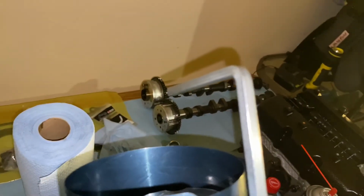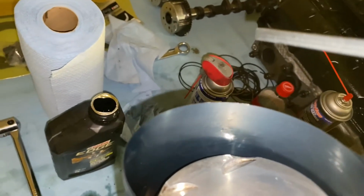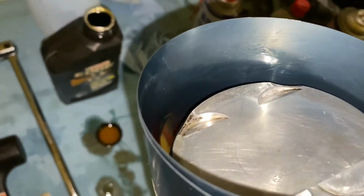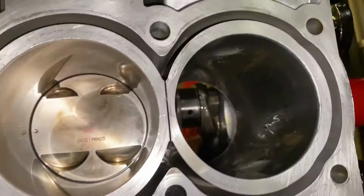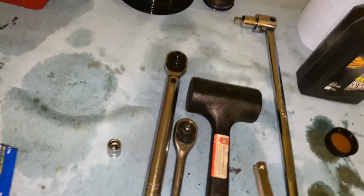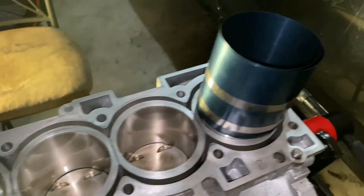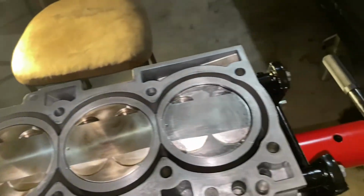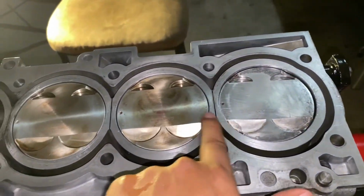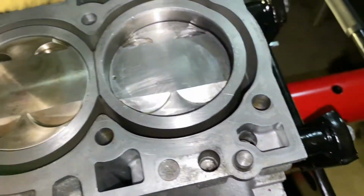and then it comes with this little angle or tool, I guess you could say, and that's to tighten it. And what you're gonna do is tighten it all the way to where the rings are compressed together. That way you can drop it in the cylinder wall as smooth as possible. And then you're gonna use a rubber mallet right here to push it down. But you just have to make sure that you don't force it down. That's just to help you push it down. All right, so then set it up and then give it a pop. And then it should go down. And this is what it's gonna look like whenever you have all four pistons in, all facing forward, of course. And then push this guy down a little bit.